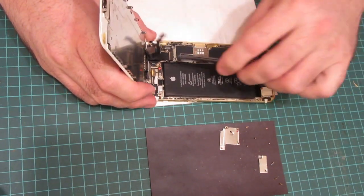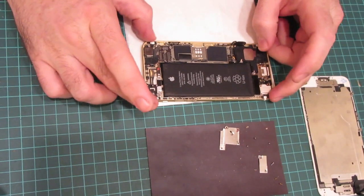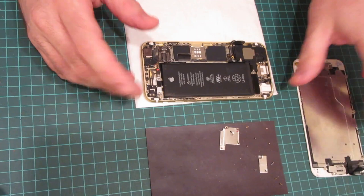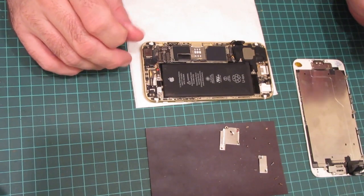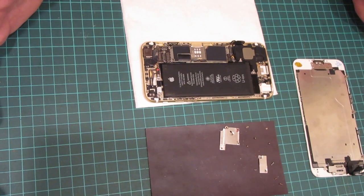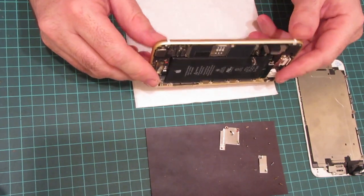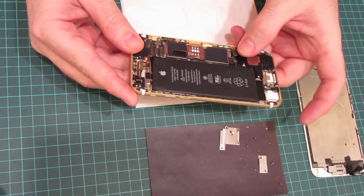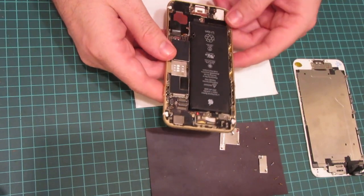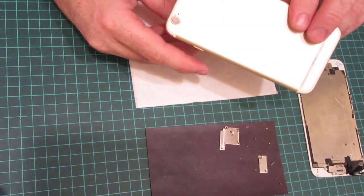Well, this is a pretty good example — I know we haven't really fixed it here. This is a good example of why I don't do water damage repairs for the person to keep using the phone. Because this was obviously repaired with the connectors being cleaned and a new screen put on a couple of weeks ago, and now it's dead. More than likely the person hasn't backed up their data, because the person who originally serviced this didn't tell them they should back up their data. As soon as a phone has water damage, the very first thing you do is get that data backed up, or you're going to lose it.